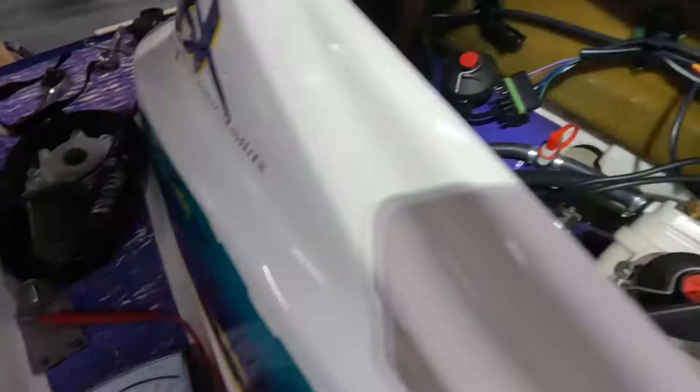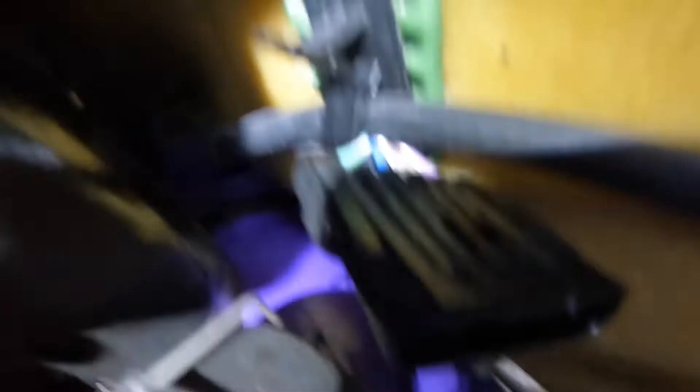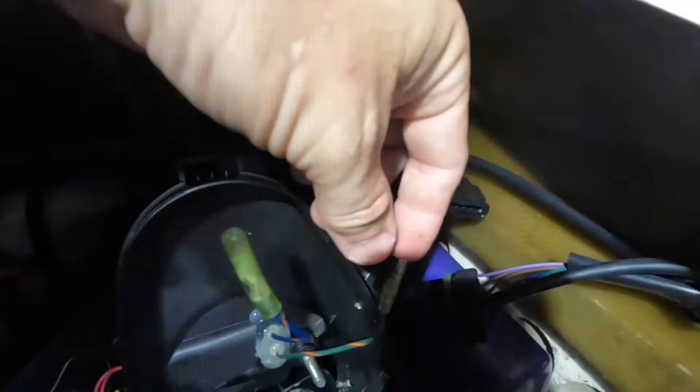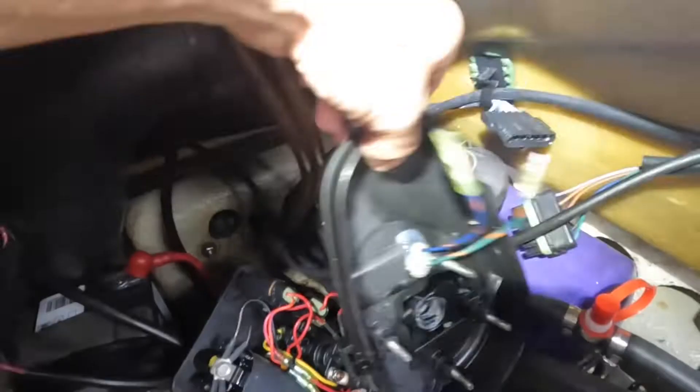I left the neutral lead in the black wire socket, moved the other lead to the green socket, went up to the button, pushed trim down — and it closed that circuit, resistance went back to zero. So I know my switch is good and my wiring all the way back to this connector is good. On the other side of this connector, running a lead from the green wire to green wire was open circuit, and blue to blue was also open circuit — pretty much telling me this VTS module was bad right off the bat.